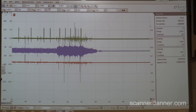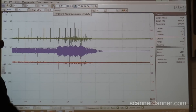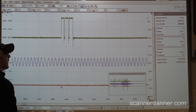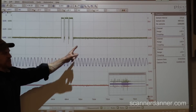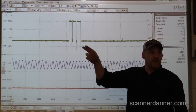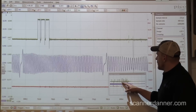Why did that try to start? Did you see what we just got? The green trace — that's my coil control. Look at it. Should we fire the coil that many times rapidly in succession? That might be a design feature — they're rapidly firing the coil like a multi-strike system. Every time that coil fires, it's doing the same thing. So we have some coil firings.